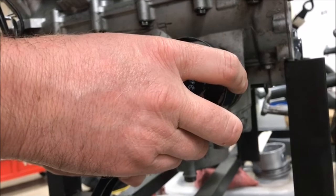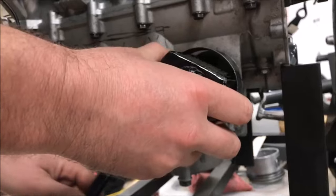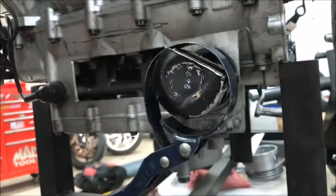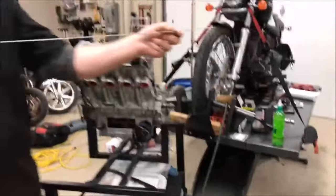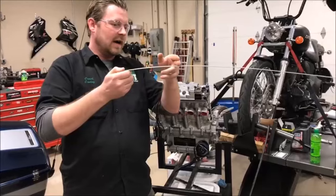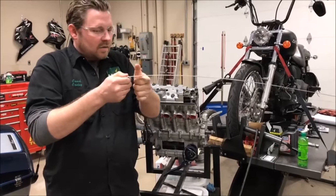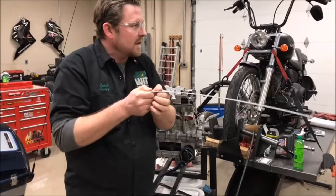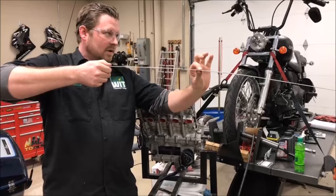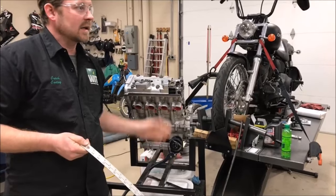What people are not doing is going all the way down to the base, and that's what's going to allow you to get a really good bite. You're not grabbing the threaded part — you're trying to get this housing where it doesn't have much room to bend. Let me paint a picture with this ruler. The further out you go from where it's mounted to the engine, the more easily it bends. But right at the base, it doesn't bend easily at all. Grab it right there and it'll take that nut with it and wheel right off. Out at the end, the thin metal just twists and breaks on you.